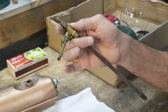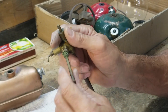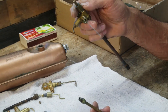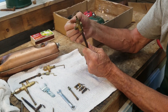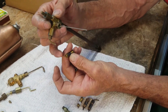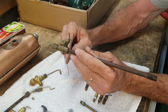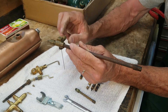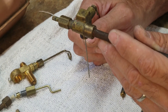This is the valve and generator out of a 425-B stove. Here is the fuel and air tube. If you take the fuel and air tube off, you will see there is a needle that goes inside of it — it's not part of it on a stove like it is on a lantern. This is called the needle; it is attached to the block, and when you turn the tip cleaner it moves up and down. On the top of a stove it says 'up to light, down to burn.' When you turn this up, you send the rod downward, blocking the bottom of the fuel and air tube so you get more air than fuel — that's how you light it. Down to burn, you open it up; the rod goes up, pulls out of the bottom of the fuel and air tube, and you pull in more fuel than air.